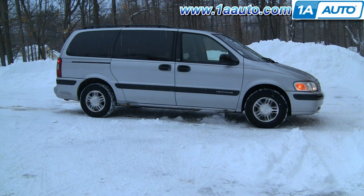In this video we're going to show you how to replace the blower motor resistor on this Chevy Venture. This is a '99, pretty much the same as any '98 to '05 Venture, Montana, Silhouette. The only tools you'll need are a 7/32 inch socket with a ratchet and extension, and you'll also need a little flexible joint.